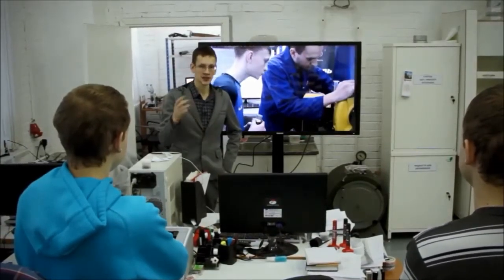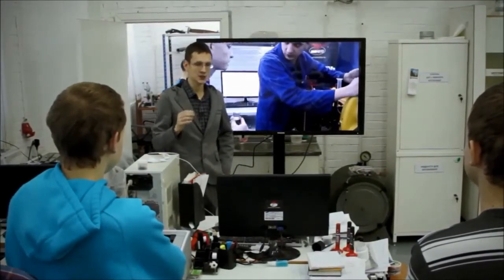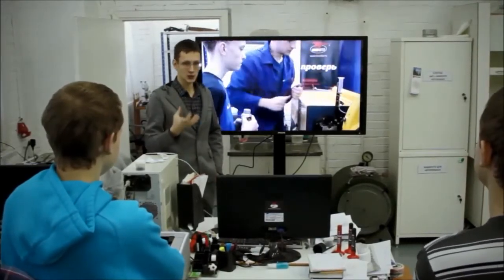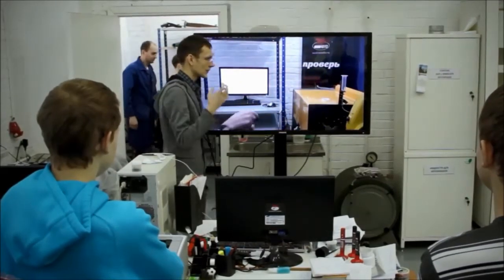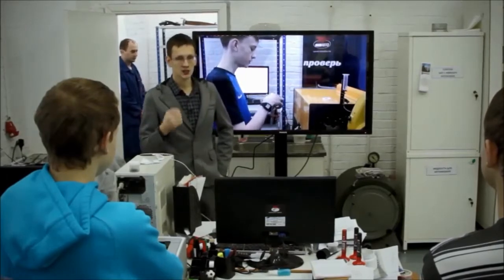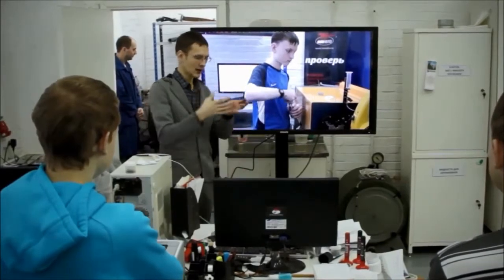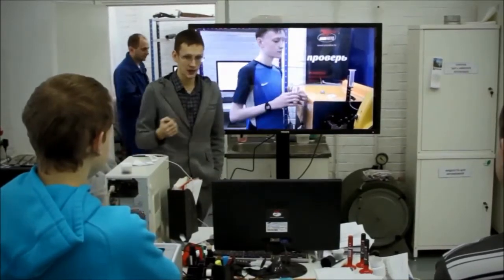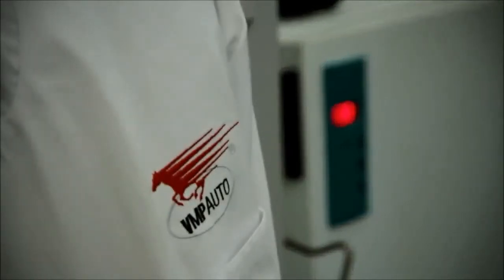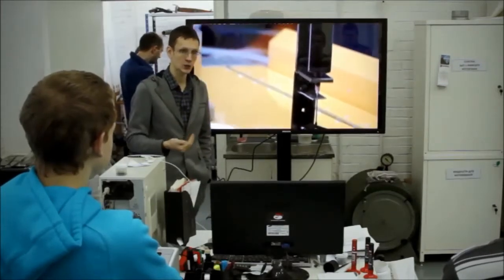This number caused many arguments, and I partly agree with them. We can't assure that the piston presses upon the cylinder with a 50 kilogram effort. But we are not trying to show you the working conditions of your engine, because all of them are different. If we compare an ordinary small car engine with a V8 diesel, the conditions will be totally different. We are trying to show you conditions common to different oils, where one oil works and another doesn't.